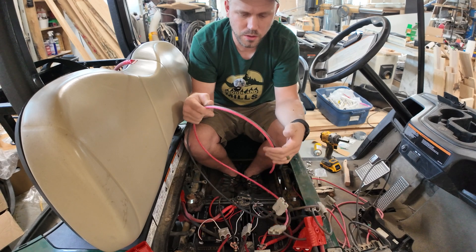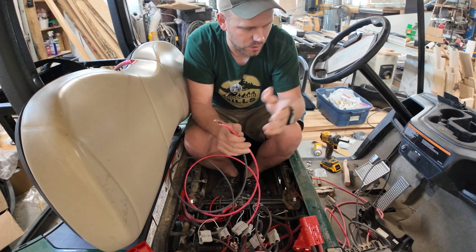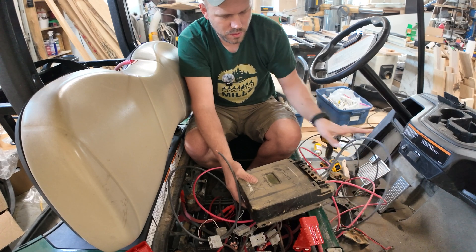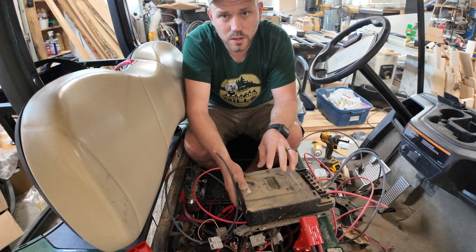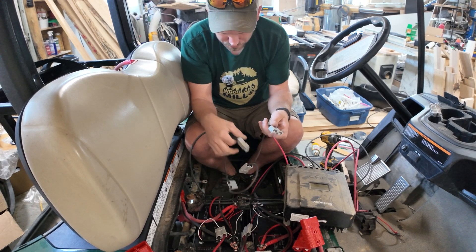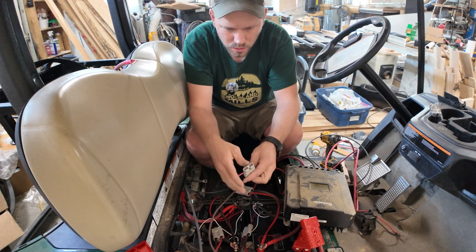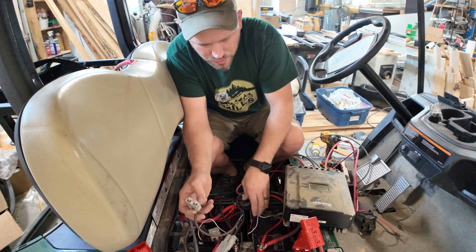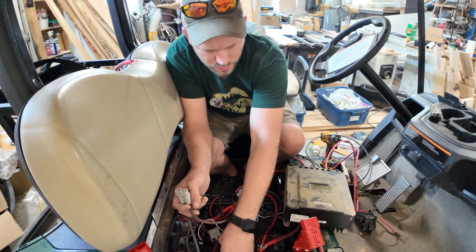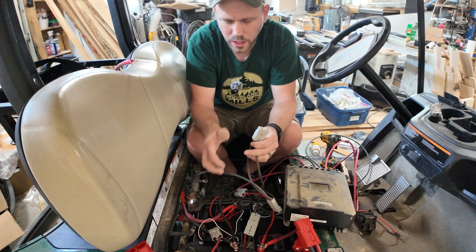When hooking up these wires, first hook them up to the charge controller so that once all the batteries are connected the wires aren't sitting around hot and risking shorting out. This is just a charge controller I had sitting around from our old camper — I'll put a link in the description for a more affordable option that will work with this same setup. You have to make sure that you hook up the batteries in the same exact order every time, because if you get them mixed up you're going to short stuff out. Make sure this battery goes to this battery, then this one and then this one — the order just has to be consistent when you connect each connector.